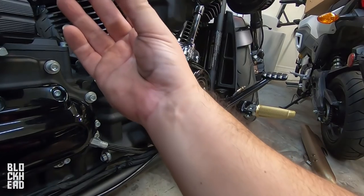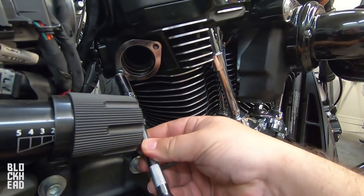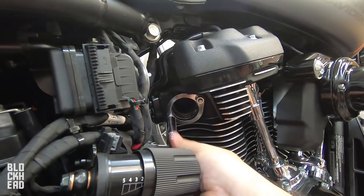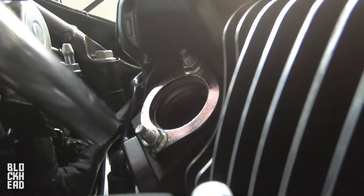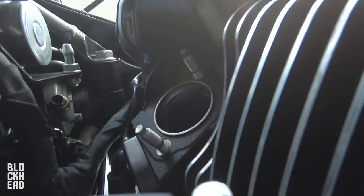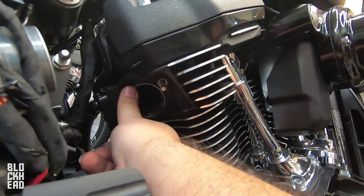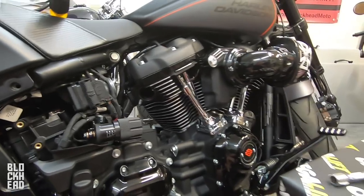Then take the flange and the C-clip and put it on there. Take the nut and lightly thread it on, making sure the C-clip stays in. What we're doing is slowly and incrementally tightening each side down so it evenly pushes the gasket into the head. Press it in until you feel a little bit of resistance, same with the other side. Pretty much almost tucked in there — that seats it perfectly. I've done this across multiple bikes and it's the trick that works best. Free tip — rinse and repeat on the front.